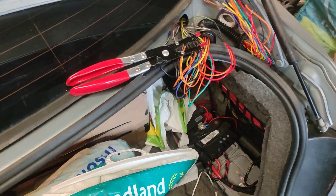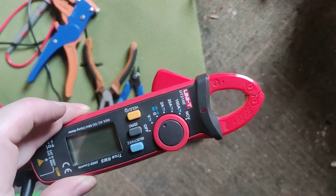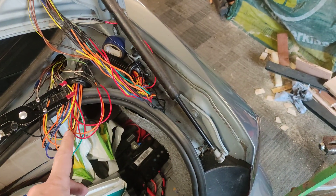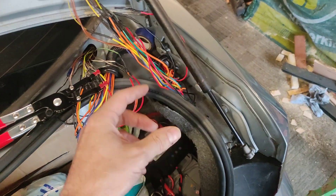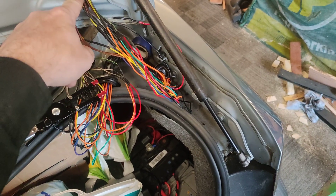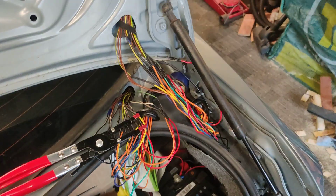You're also going to need a multimeter. I highly recommend the UNI-T UT210E — there's a newer model now. The reason you want that is so that if you've got all your wires chopped and you're trying to figure out which orange wire is which, you can put your meter in continuity mode and buzz them out. Another tip: don't strip all your wires at the start — strip them as you go. Strip one side, use the multimeter to find the matching wire on the other side, then strip that one immediately and leave the rest unstripped.